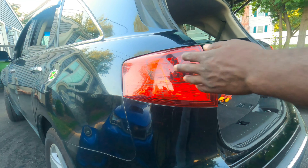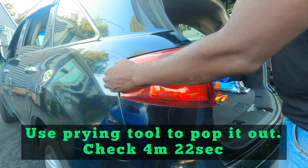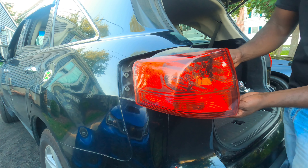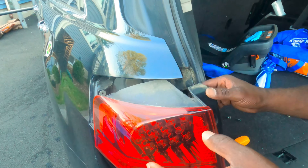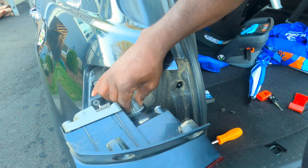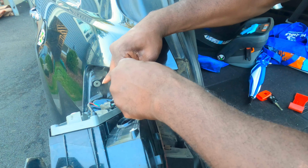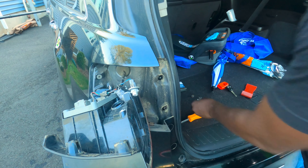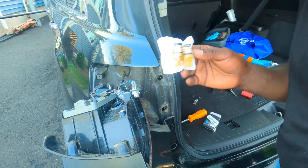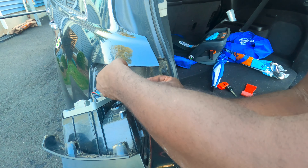Alright, to take this out there are like one and two pins here. You may need to get your fingernail in and then push it out. It's not easy, but mine came out a lot easier than I thought. Okay guys, once the light is out, just tilt it a little bit — this is the turn signal. Twist, and there you go. Here's the bulb; pop it out. This is the new one we bought from Amazon.